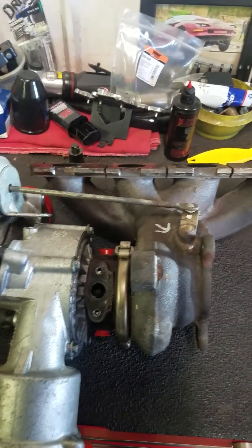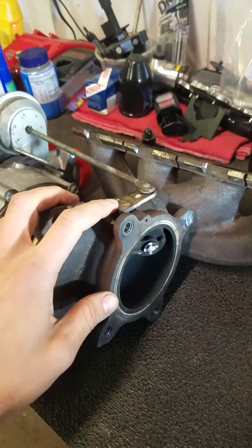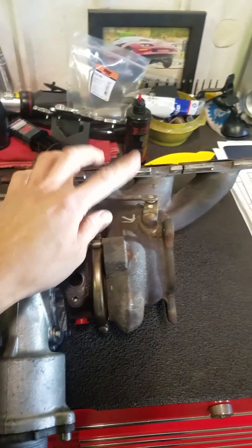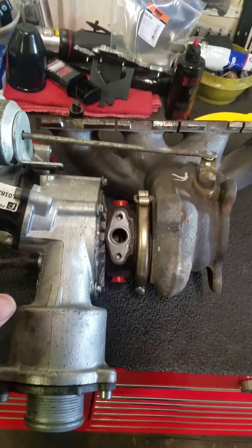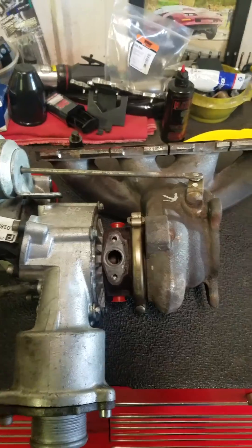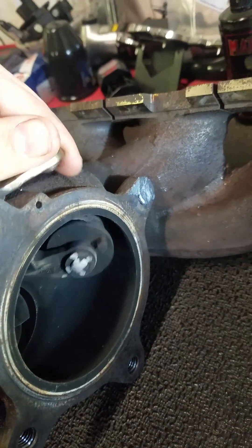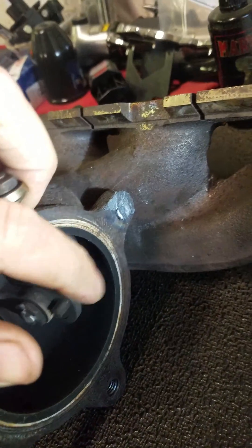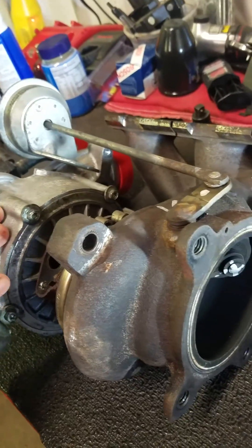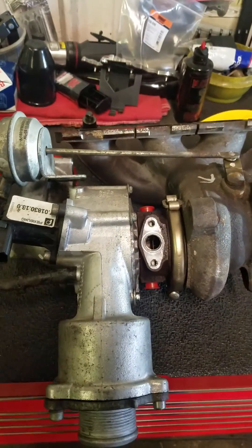Kind of the sad thing is the rest of this turbo is in really good shape. It seems like someone would make a repair for this other than replacing the entire turbo, but from what I can find, they don't. They make the anti-rattle clips and a few other things, but as far as fixing the underboost code, the only way to repair it is to replace the entire housing and turbo. When this doesn't seal, that's going to let exhaust gases pass by — it's not going to spool correctly, it's going to be underboost, and your boost level is going to be lower than what it should be, which is what's going to set your code.